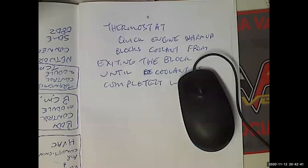All right, drain and replace fluid and filters. Well, we already talked about that a couple of weeks ago, either 3 or 4 weeks ago. Here's the important thing, inspect powertrain mounts. What does that mean? Well, every transmission has mounts, every engine has mounts, and it's very important that the movement limits of engine, transmission, and other driveline components are not exceeded.